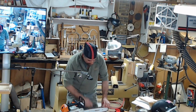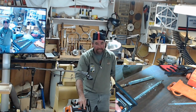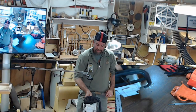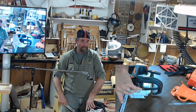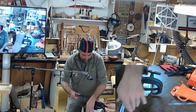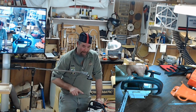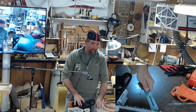Another thing, and I don't know about some other saws, but like Stihl and Husky, there is a line on that tooth that you can match up. That's the angle you want to stay with. That's also the marker saying that there's 20% left of this tooth, time to get rid of this chain. So you want to always stay in that seam. And you want to have the exact same number of strokes. Say I ding one side of the saw and I have to do 5 strokes on that side, I have to turn it around and do 5 strokes on the other side.